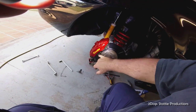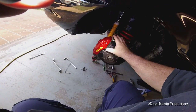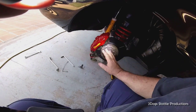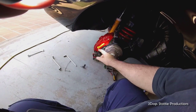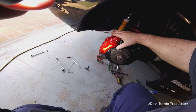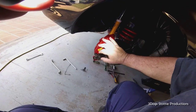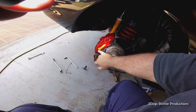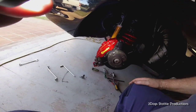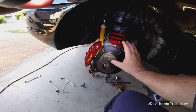The caliper is nice and pretty. Don't use high-temperature stickers - they don't work. When you bake the high-temperature paint in the oven at 100 degrees for an hour the high-temperature decals change color - mine were yellow and they went orange. For these rears I used a stencil, painted with high-temperature yellow, let that go off, gave it a quick sand, then cleared over the top of the whole thing. Looks pretty good.